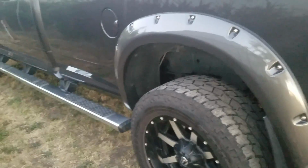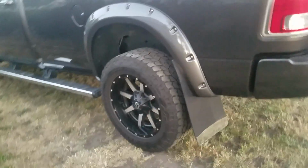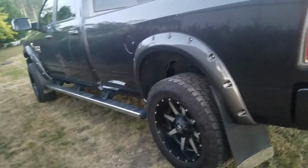Couldn't be any happier. So, do your conventional balance. If that doesn't work, yank all the weights off, put beads in there, and you, my friend, are going to be one happy camper.